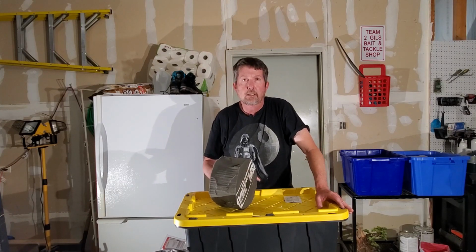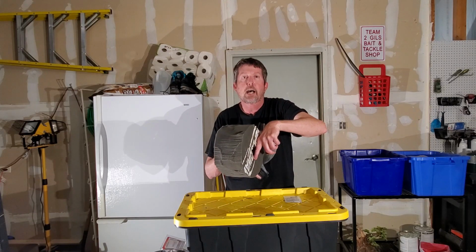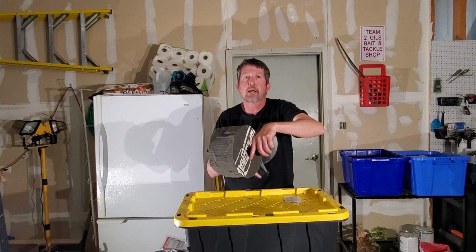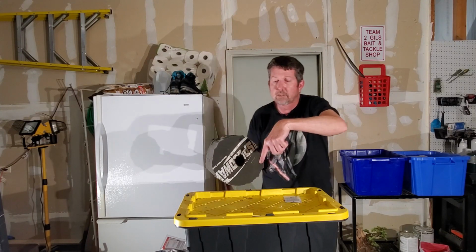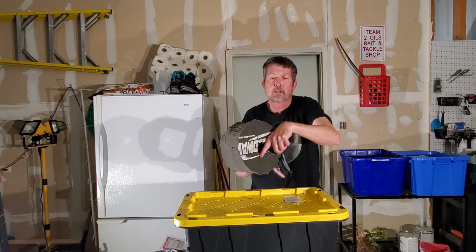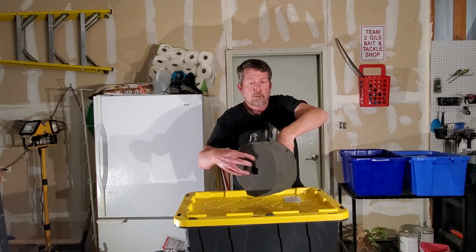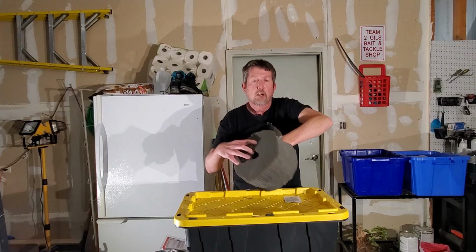Positive caster is when it tilts backwards. So the top of your spindle is towards the back end of the bike versus the bottom of the spindle toward the front. What that's going to do is, if you tilt this thing back like that, it's going to cause your front wheel to have to swing up like this. So instead of just going perfectly perpendicular or horizontal, it's having to do an arc.